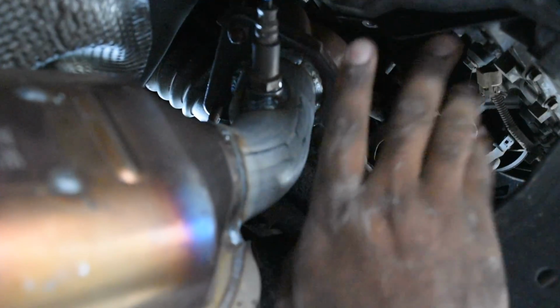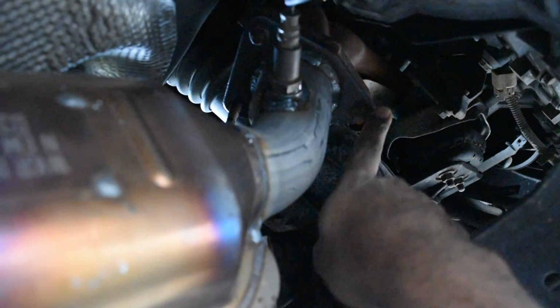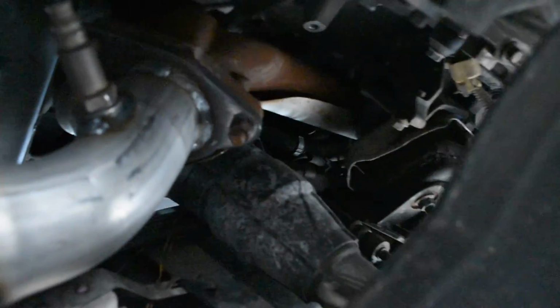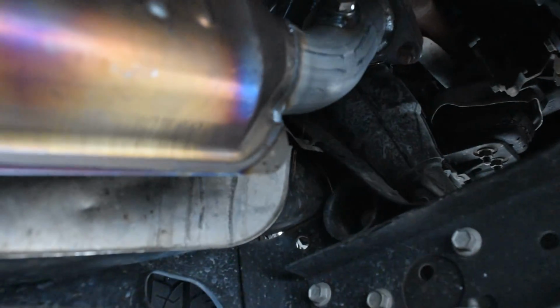And once you have your transmission supported, you can go ahead, take out these 2 screws fully, take out these 3 screws, bolts. My hand's getting more and more ashy because I'm touching metal and whatever. Take out these, try to get a good view of it. There we go. 1, and there's another one, 2, and of course the third one is there. Like I said, it doesn't have a bolt on it because the screw was stripped. Take those out. That's the driver's side of the vehicle.